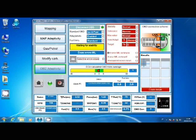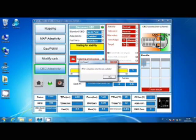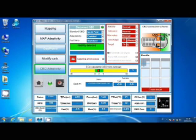Now selective errors erase is not enabled here. Now I enable it. Well, it turns red. By clicking here you get some information. In this case, ECU is on petrol, error list not available. This is because while we are on petrol we are not monitoring these latent errors, okay? So while we are on petrol you don't have any information. And gas.